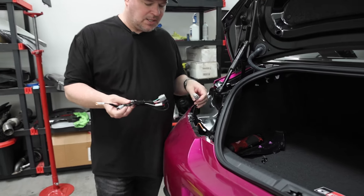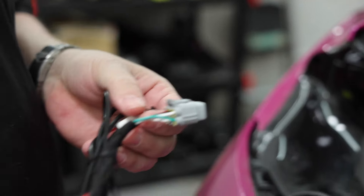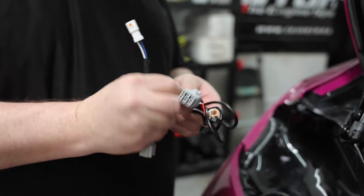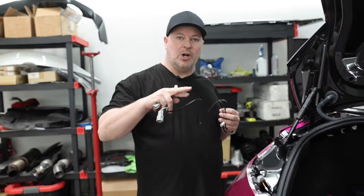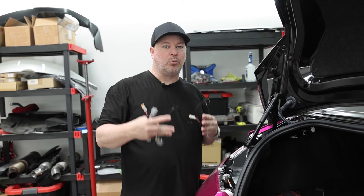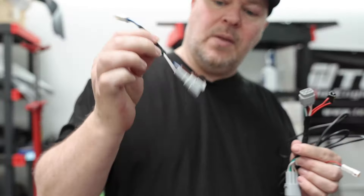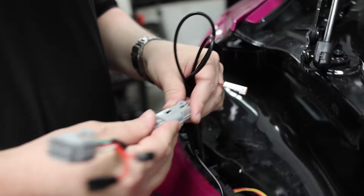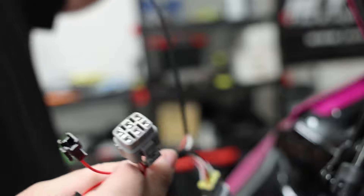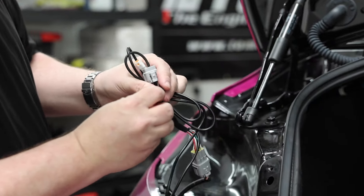Once you get the taillight removed, this is the key part. We've actually worked with the manufacturer early on and got these wires repinned for USDM. It's pretty common first time around — they always send them and we always have to explain that the US cars are just not the same. They've been like that since the gen ones, and what I mean is basically the parking light and the turn signal are actually reversed. So if you see anyone and their lights are doing something different, even on these new gen cars, it's probably because of that. What we have here is a complete wiring harness that's going to go on the bottom lower side and connect between the OEM harness and our Valenti tail light. This will actually change the setting on the light itself, so we're going to plug this in right now.